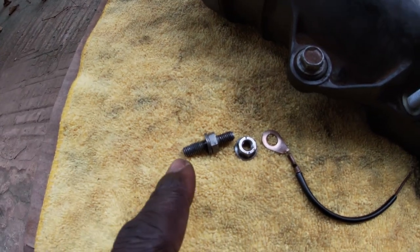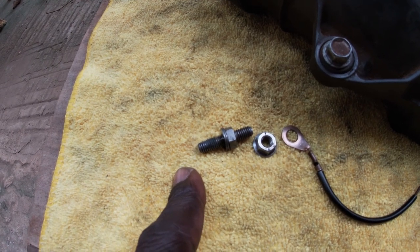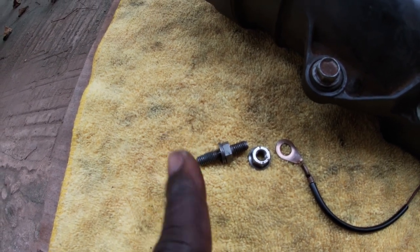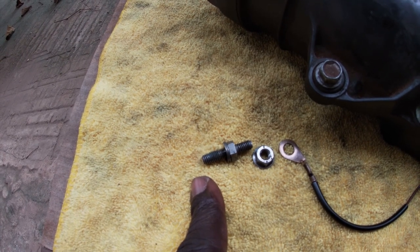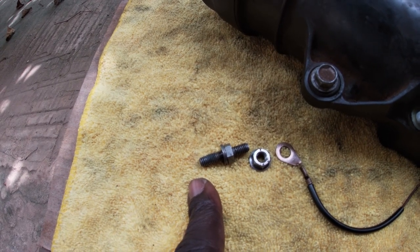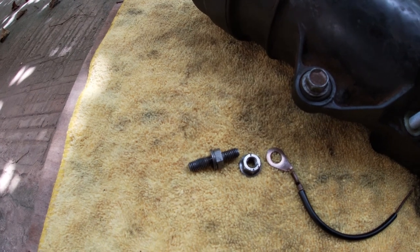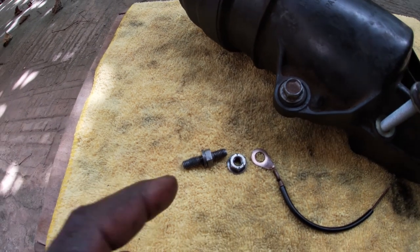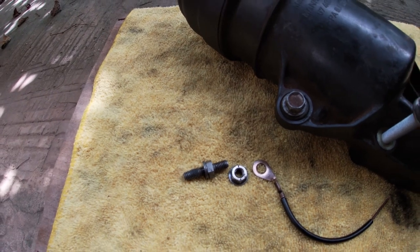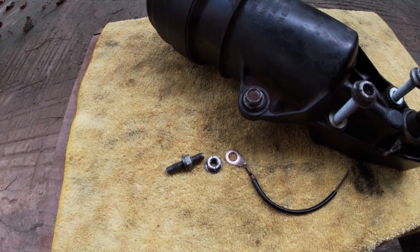This double bolt holds two brackets at the back of the engine, one black and large, and two small ones, one gray and one green. The black connector connects the fuel injectors on the driver's side and also the low pressure fuel sensor, I think, something like that, or a fuel pressure sensor. And the gray and green connectors are for the knock sensors.